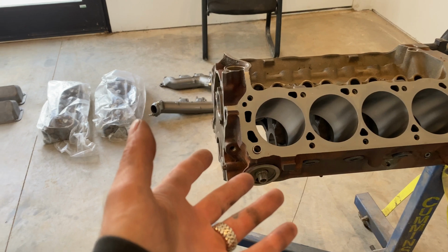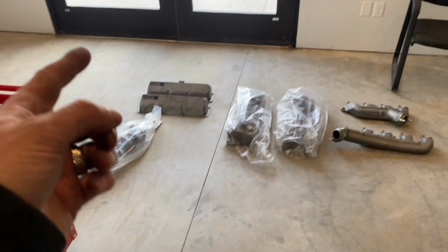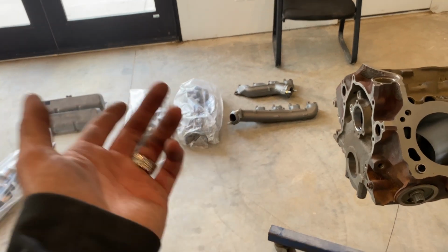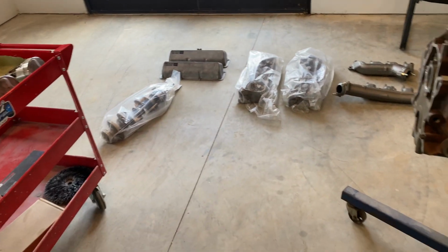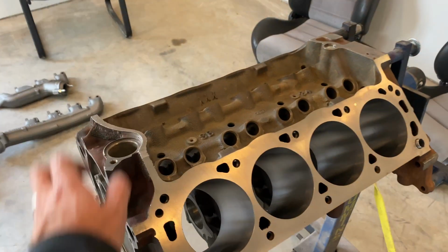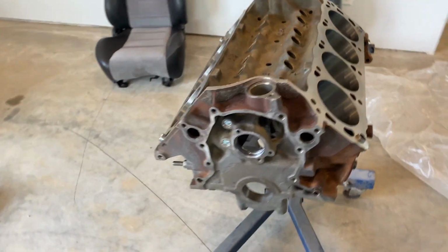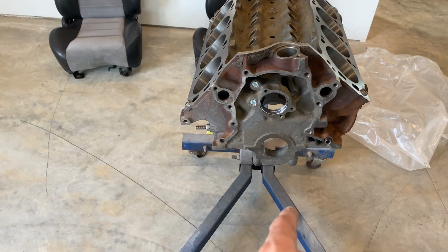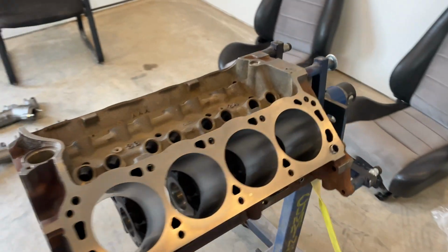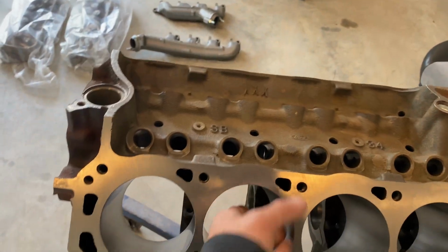The things we didn't use but look original: crankshaft is just as strong, heads basically the same thing, and yeah, I don't know if I missed anything, but we're going to use a Comp Cams. That's a reproduction of the Boss 302 cam, but it's a roller, so it's more reliable with oils nowadays. So that's a little summary of it.